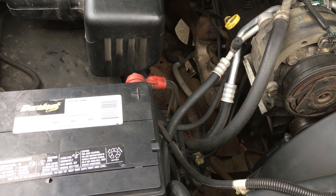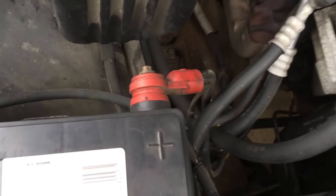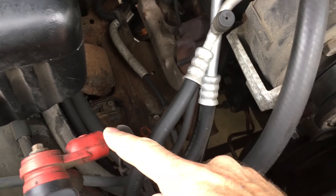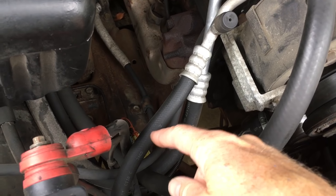Here's how to replace the starter on the Chevy Silverado — this is a 95 model, and they're all pretty similar. We're going to unhook the battery first. You can see this wire goes from the battery down to the starter, and we're unhooking it so we don't get electrocuted, but also so we can have some slack.